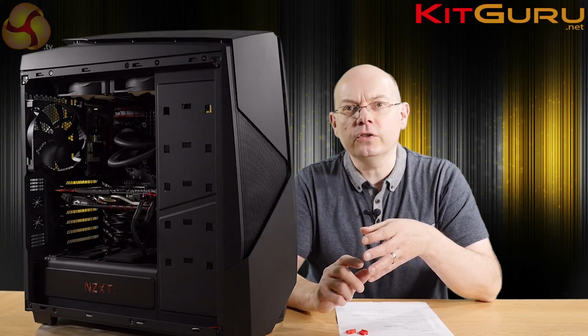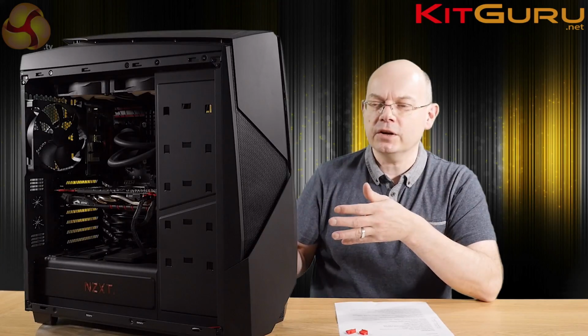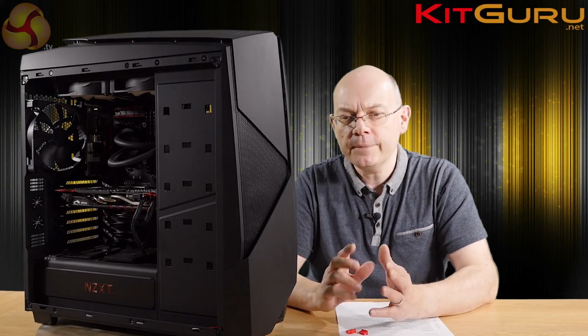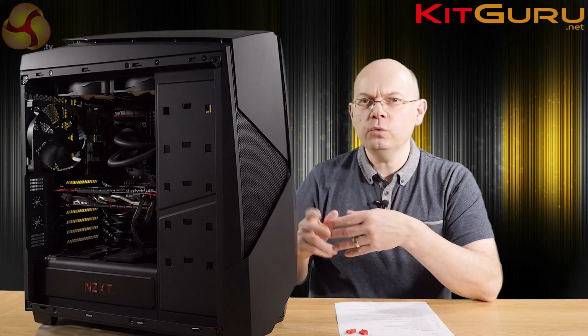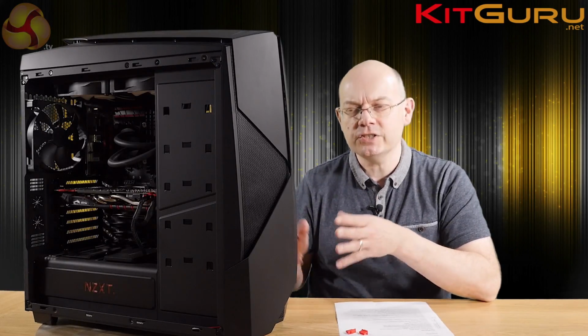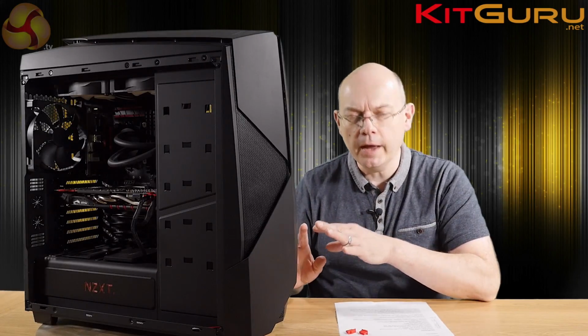After that, I had a look at the software and I thought, right, there's a few things obviously missing here. It's an MSI motherboard, MSI graphics card. There's no Live Update 6 installed. It's the obvious utility to use. It is a good bit of software. I installed that and it popped up saying these drivers all need updating. The BIOS, for example, could have been updated. I didn't touch it because it's an overclocked processor. If you change the BIOS, that can muck everything up, so I didn't go there.